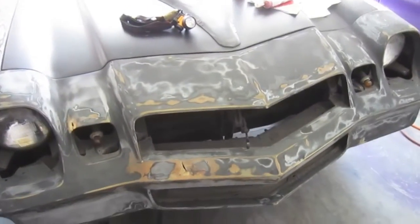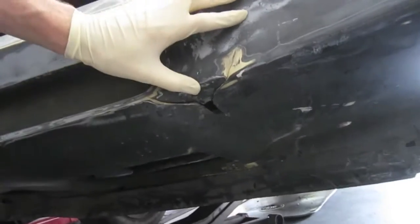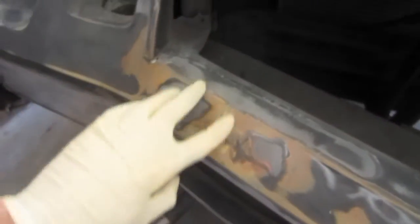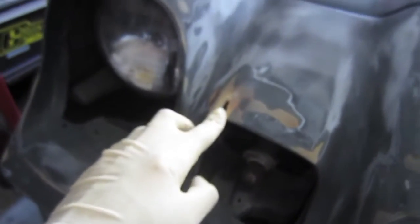Now for anyone who's familiar with these cars, you know that on these second-gen Camaros these urethane front bumpers over time got hit, dinged around, and they wind up cracking somewhere somehow. Right here we've got our biggest crack which will be the most challenging to fix but at least it'll be somewhat hidden. We've got number two right here, and then there's a little one right here and actually there's a fourth crack right there.